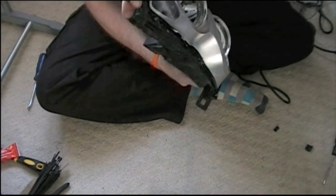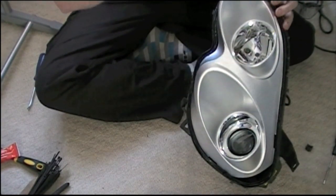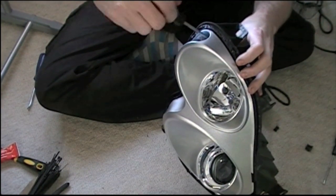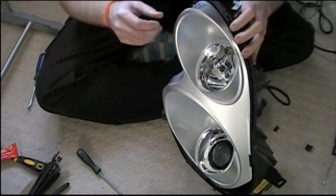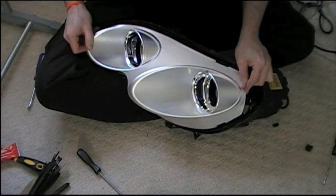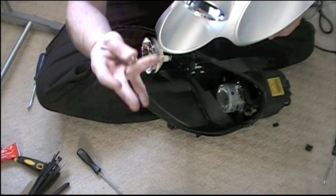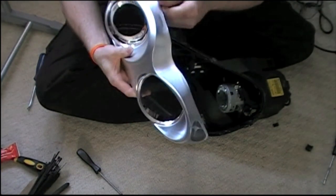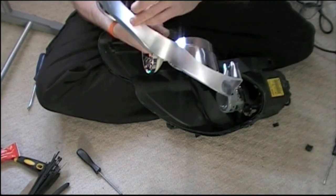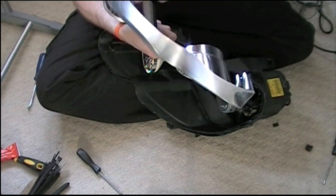What we need to do now is in the front corner there's a Torx screw - T20. Remove the T20 screw and pull the whole headlight forward. Don't lose the screw - and there you go, you have the reflector cover off. If there's any mastic stuck to the other side of it, just get a lump of the mastic and dab away at it.